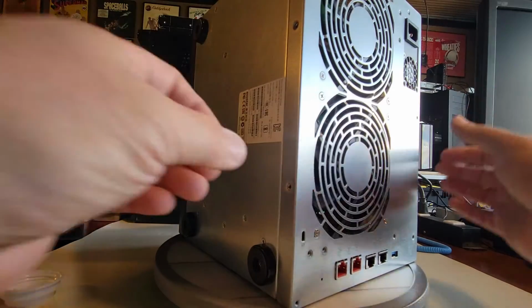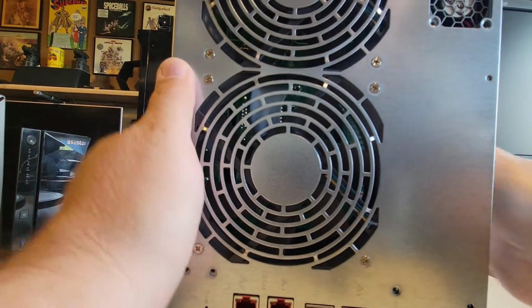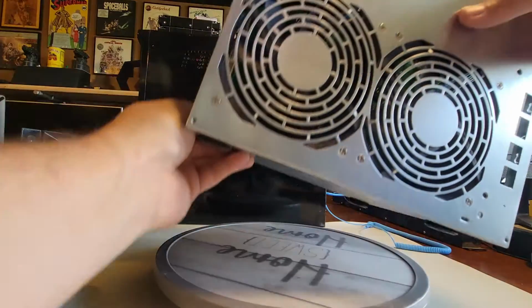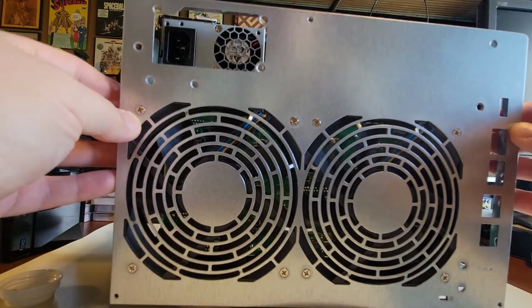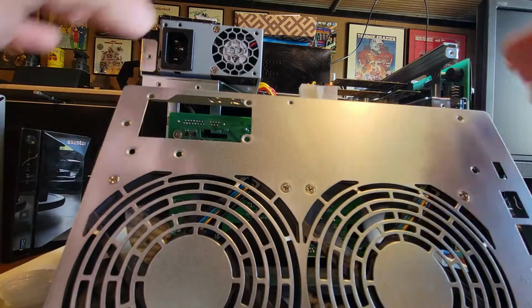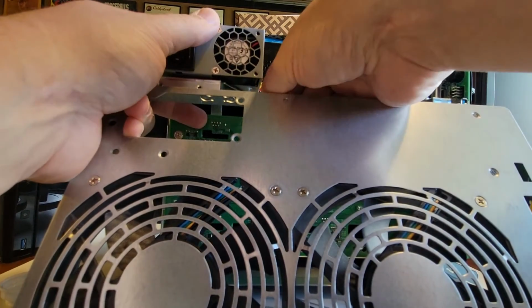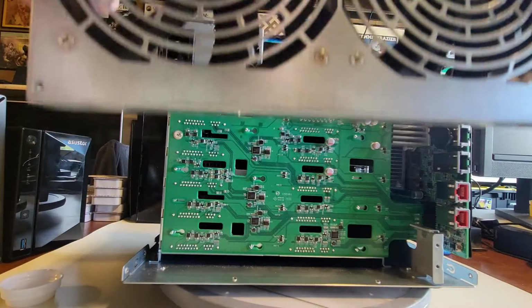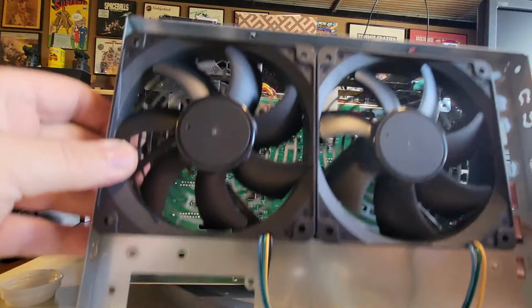Okay, so now we can get access to that bezel. Let's pull it off of the Lazy Susan just a little bit. And now you can start. Oh, there it goes. All right, let's put it squared back up, get the weight off that system board, right? And there it comes. Okay, now there's two fan connectors right here. Probably can't see them off video. I'm just going to disconnect them. And now, voila, there's our internals. Here's our fans, right?